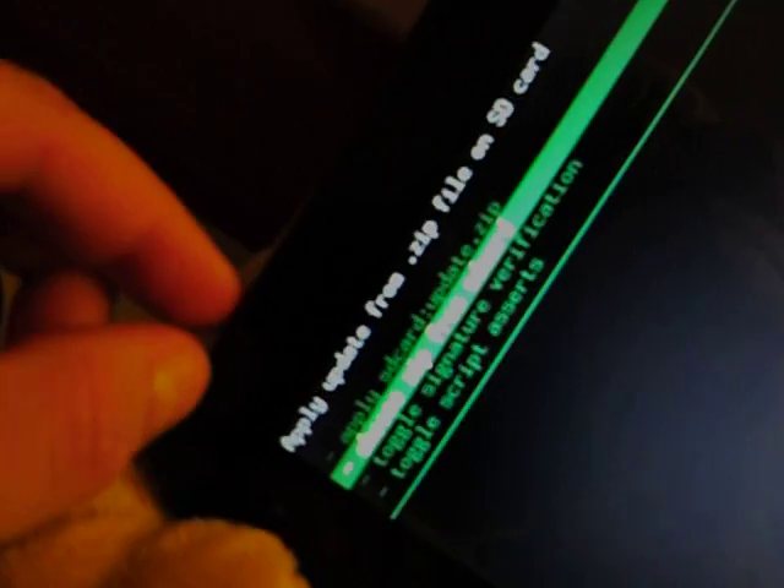Let's go ahead and power down our tablet now — we're going to power off. The main thing guys is to boot into your recovery. You're going to hold the power and then the volume plus at the same time, and you're going to see a message that says 'detect a recovery key pressed' and it's going to go into the bootloader. So here we are at the bootloader. We're going to use our volume rocker to select 'install zip from SD card', then hit our home button and choose zip from SD card.